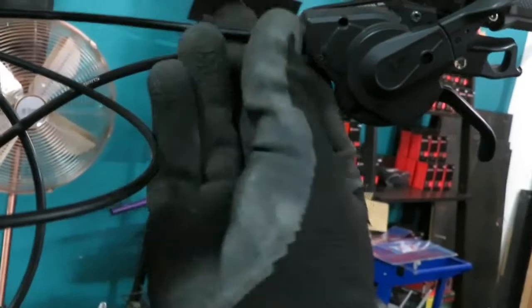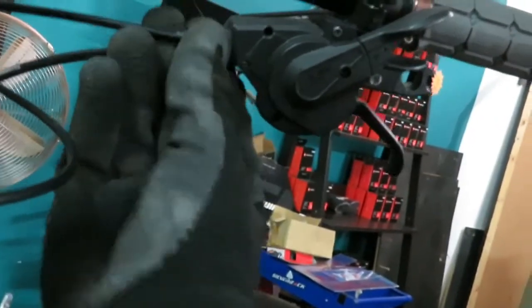What happened now is I actually tried to set it and you can hear that sound — so it doesn't want to go on there. The thing you're going to have to do is there's not enough tension on your cable to take it up. So what you're going to do is put some clockwise or anti-clockwise tension on your cable — not too much. I know how much I've taken out, so I'm just going to put the same amount back and then it should go on there.